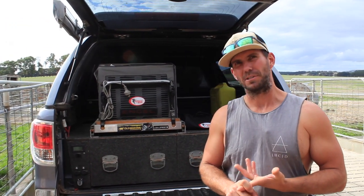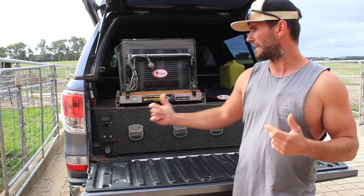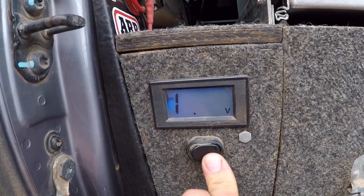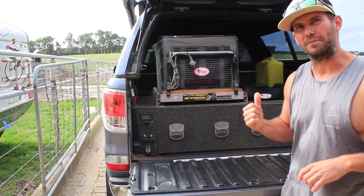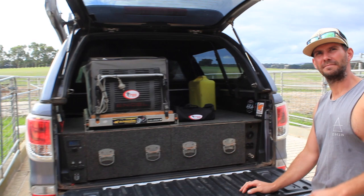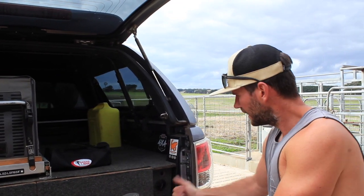What you do need is to power it up. There's an inline pressure switch in there, so it always keeps your tank topped up at 150 psi. You either need to power it up via ignition switch, or for me, I've just powered it up through my LCD voltmeter here. So as soon as I switch this on, the air compressor comes on, and once the tank is up to 150 it'll cut out on its own. There you go — it's just cut out at 150, so the tank's full of air.